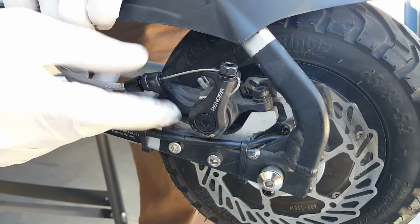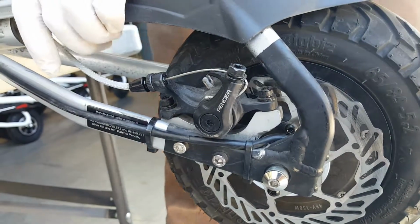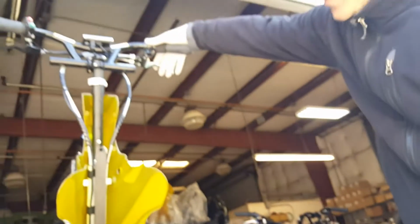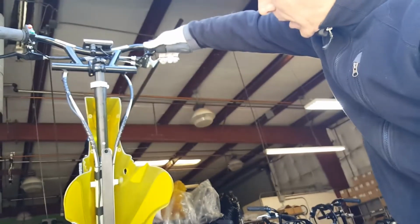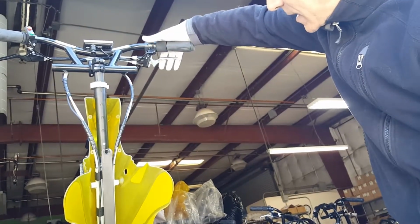The brake should be on halfway the travel of the brake lever. You see, halfway it should grab, so this way also the parking brake will act easier. So you will be adjusting this.